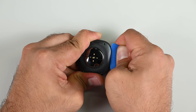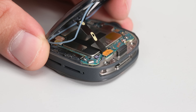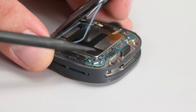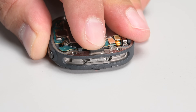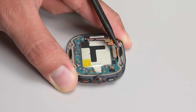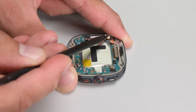There's some adhesive and a gasket in place to help prevent water ingress. And like the Apple Watch Ultra, the sensor plate detaches by popping a press connector. With the sensor plate away, we can take a closer look at the strap attachment mechanism. This is an entirely different mechanism to what we see on the Apple Watch line and feels a little bit more durable. The main board of the device looks to be the next component to come out, and surprisingly it's only secured by press connectors and a single screw.